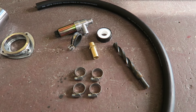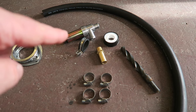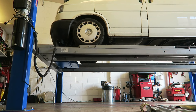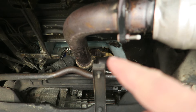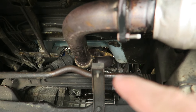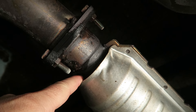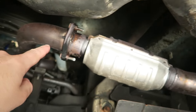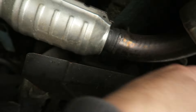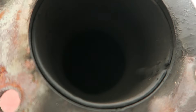Here we've got the three-quarter inch BSP tapped into the inner manifold for the Mark 2 idle control valve. So the downpipe is going to be blended in from there — we're going to take this kink out and come straight down. It's been quite restrictive, going down to maybe like a two and a quarter inch here for the cat. The cat's going to be moved further downstream, and we're just going to have three inch all the way down here with the cutout and a side exit coming out that way.